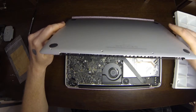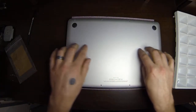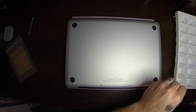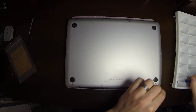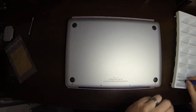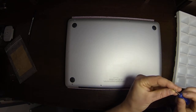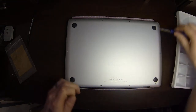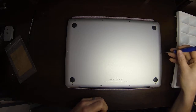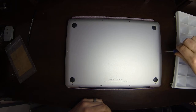To put things back on, you just line the lid up along the back and let it fall into place. If it's a 15 or 17-inch model, you can push along that center part to help snap those clips into place. All we need to do now is put the screws back in. The three long screws go along the back side where the hinge is — I'm going to set those in first. What I like to do is start the threads on all screws without tightening them yet, because sometimes the holes don't line up properly. Also keep in mind these screws go in at a slight angle — not straight down — so make sure you're going at that angle when screwing them in, otherwise you can strip your threads.